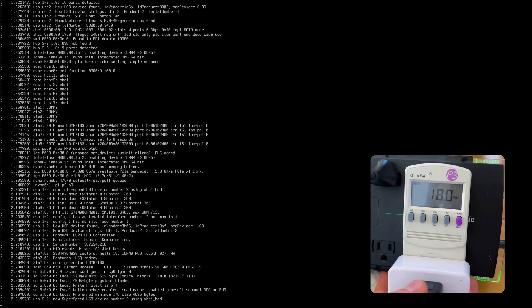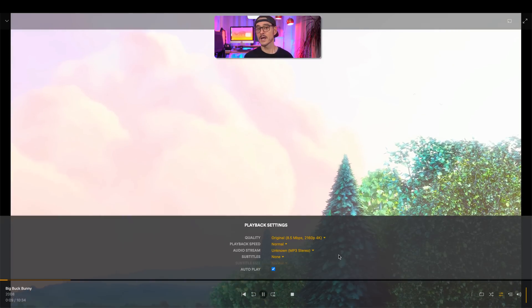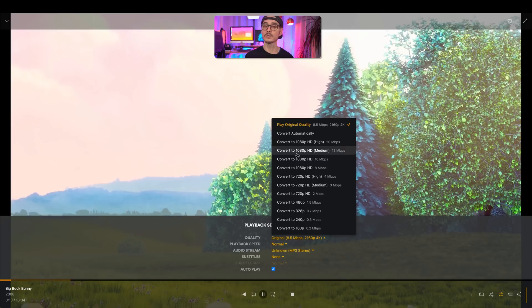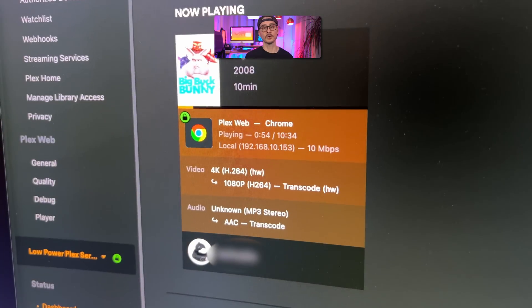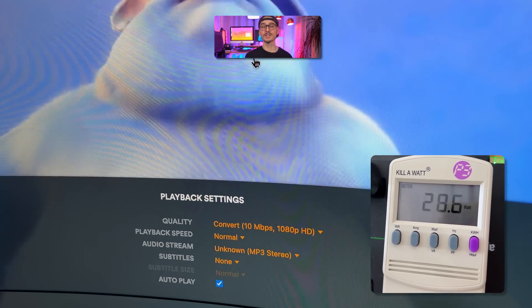Remember how I mentioned Linux earlier? I tested it too and was super surprised. When using Ubuntu Server, I saw it hanging around 17 to 18 watts at idle. When using Ubuntu Desktop, I saw the same — 17 to 18 watts. This totally busted a myth I've had for many years that Windows at idle uses more power than Linux. At least with Ubuntu, Windows is just as optimized. The next question was how much power it uses when transcoding one video. I started streaming and transcoded a 4K video down to 1080p — it's using QuickSync from the integrated graphics, and it's only using 28 watts, just about 9 watts more to transcode.